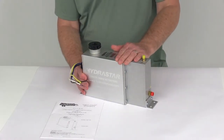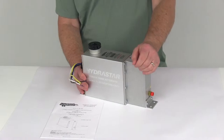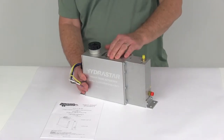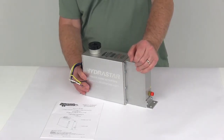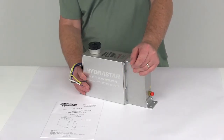This has a 1,000 PSI pressure rating, which is suitable for drum brake applications. It will work on single, tandem, and triple axle trailers with drum brakes. This actuator will eliminate the feel of being pushed by the trailer, eliminates any problems found when backing a trailer uphill with surge brakes, and eliminates brake drag, which is common with surge brakes on a downhill grade.